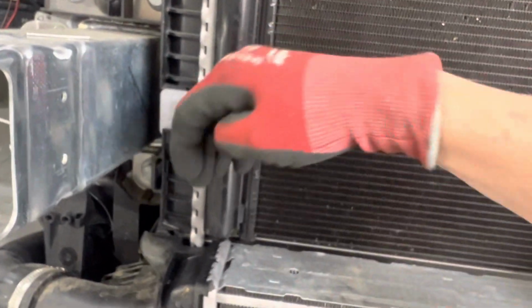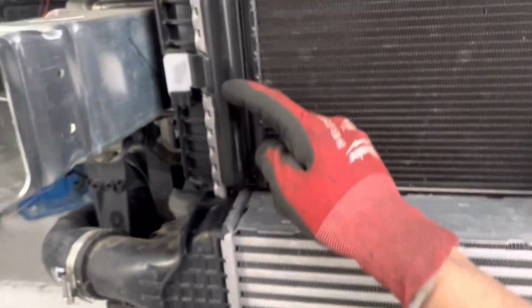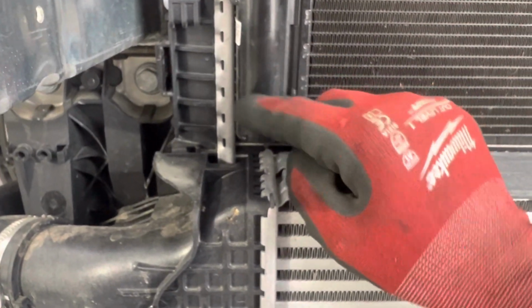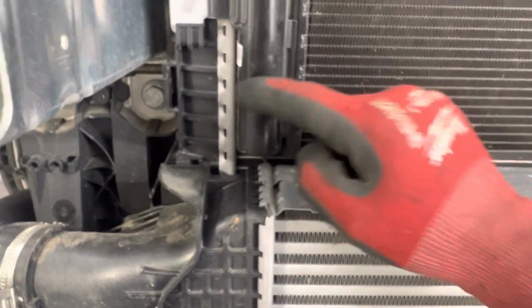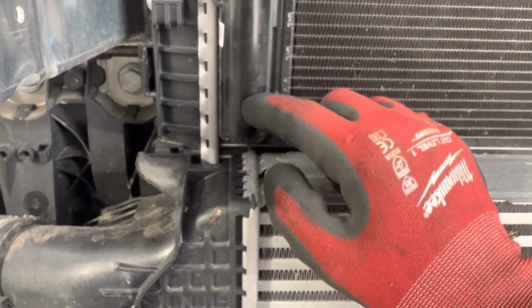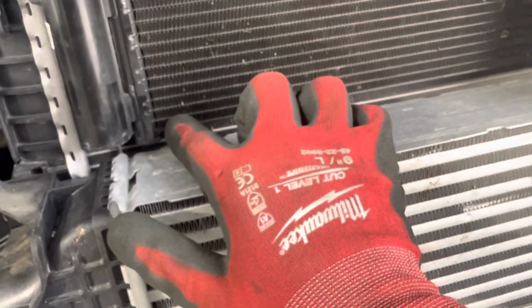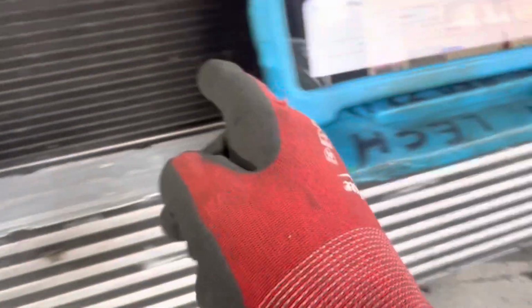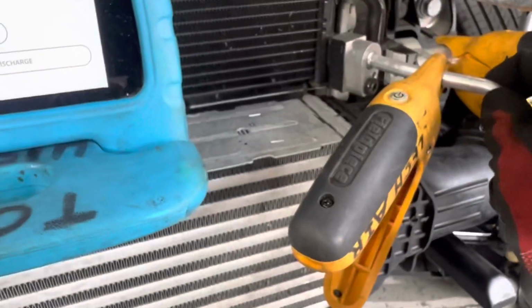And the liquid falls down, the vapor fills up the system, and the oil is with the liquid, and it all goes down and goes through a filter that's right in here. Then it drops to the bottom under here. There's a separator right here. As it goes through the filter, this will be all filled with liquid oil and liquid refrigerant. And then these last, let's say 5 or 6 tubes will all be solid liquid going across the condenser and coming out this liquid line.